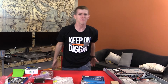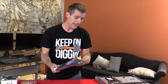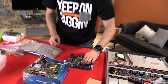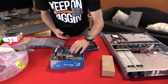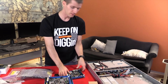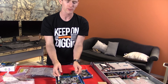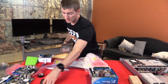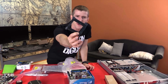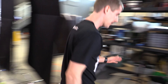We're going to start by testing this motherboard outside of the system to find out if it works at all before we introduce variables that might kill it. We'll start with CPU installation — this CPU is known good, I ran it right before starting this build log. RAM is very unlikely to be killing the motherboard; it's on the validated list and it's Kingston RAM. A lot of people say it's my cooler and backplate killing the board, but did you even watch the video? The entire backplate is covered in electrical tape.